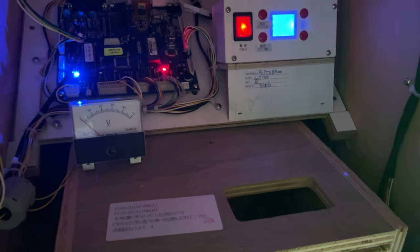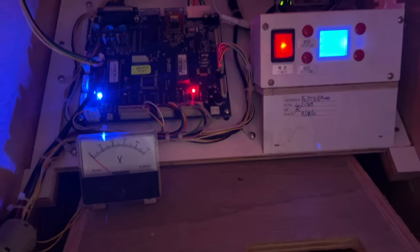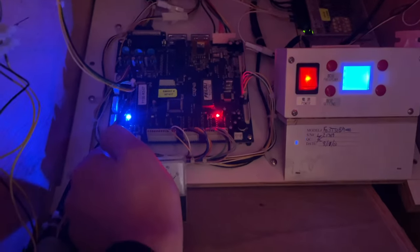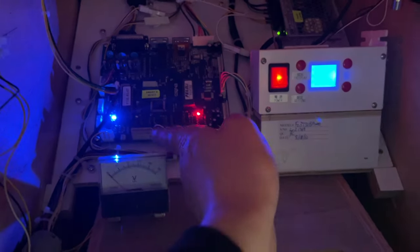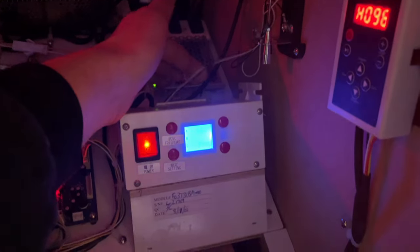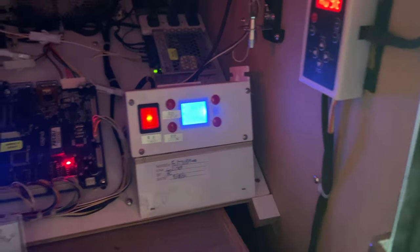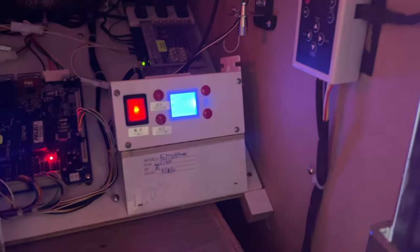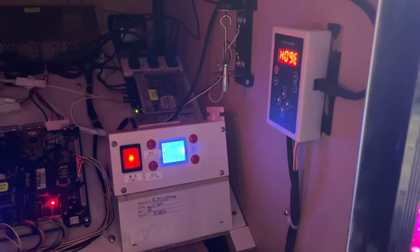The other issue is if you have it loud enough so you can hear the alarm, the volume is again too loud when you're playing. If you're installing this into a Smart Industries crane, all you have to do is disconnect the J2 connector, run the wire down behind this panel, mount the alarm board, take the wires for the tilt sensor, cut them, connect them to the board, and connect your alarm.